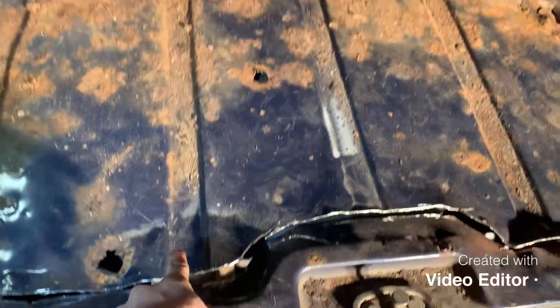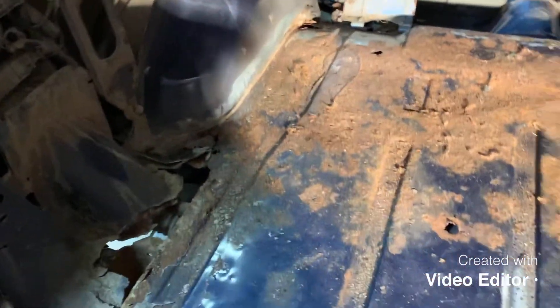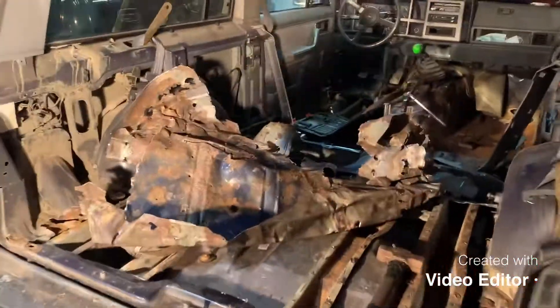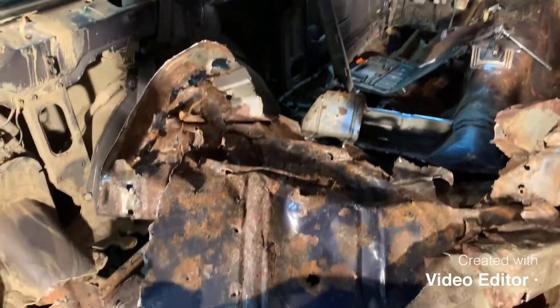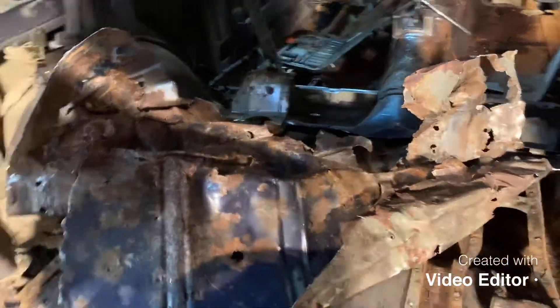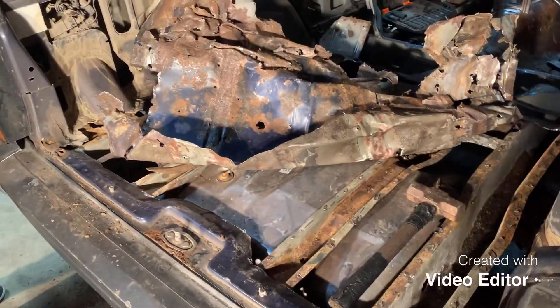Alright guys, I got that all cut and pulled up. There's probably spot welds all through these little lines so it's probably gonna be a pain to get off. I gotta mark out back there, do the same I just did here and cut the sides. Alright, Morgan's still out here and Don came out. We just got that out — completely out. I took it out in one piece, used the air hammer on the spot welds, kept pulling back and hit it with a hammer. Didn't take too long. Now we gotta try to make a piece of metal to fit all this. I'll make separate pieces for each corner and get this main area covered with metal. Gotta clean the frame rails and everything — you guys will see that in the next video.